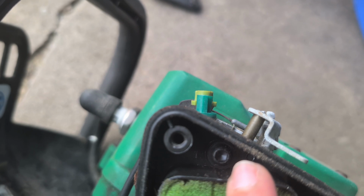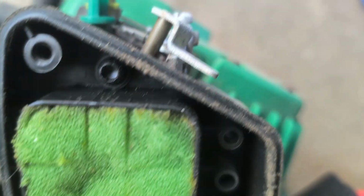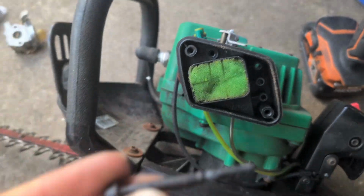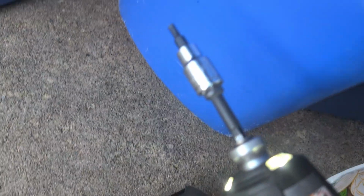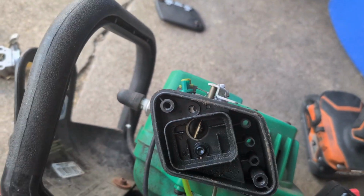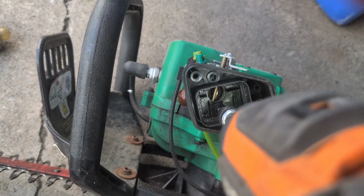There's like a hex nut in there, or a screw. So you gotta find the proper one for that, like an Allen bolt, and remove that one. That one was a very long screw or bolt. Put that one to the side, and I use one of those bits, and that's gonna be a number 4. That's gonna come out. All right, I misspoke. You have to remove the little filter from there because there's a second bolt, and that's gonna also release the carburetor from the cylinder back there from the machine.